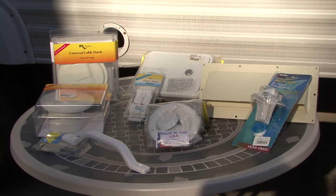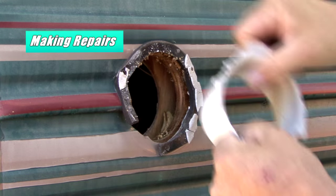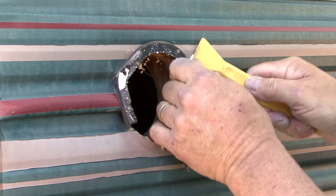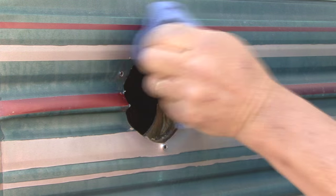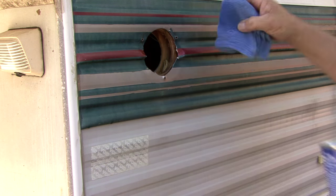After a thorough inspection, we purchased our replacement parts. It's going to take a while to replace all these parts, so we better get started. The first step is to remove the old damaged part and clean the surrounding area. I use tools like these plastic scrapers to remove old butyl and putty tape or foam gaskets. Clean the area using a cleaner compatible with the surface you are working on, and as a final prep you can use denatured alcohol on a clean rag.